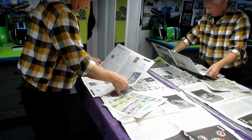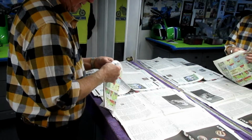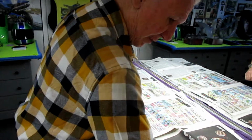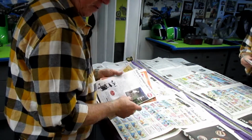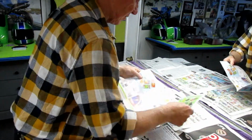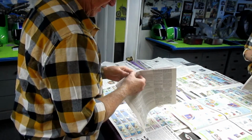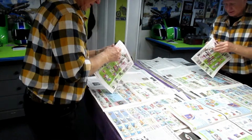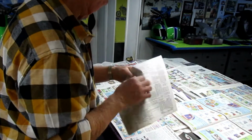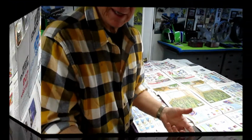But now, there was a time when Dave Midgley used to have pieces of Teflon that we could work off. I don't have that anymore, and you don't really need it. You can do one of two things. We could use PVA, which would be fine so we can release the glass, or we can just take the equivalent of Saran wrap and wrap it around, because this material does not stick to Saran wrap. So we'll see if I have a new roll of Saran wrap. I know I have some PVA, but the big thing is I don't want to ruin my workbench. Every time I do this, it does get sloppy.